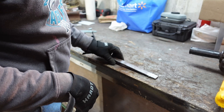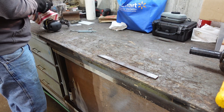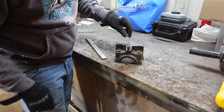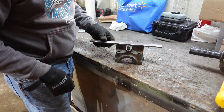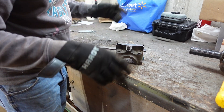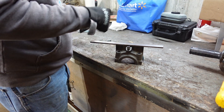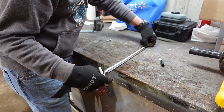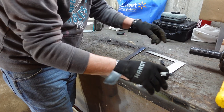So now, referring to the workshop manual as I mentioned, we're going to cut and drill holes in this to get these bolts lined up so we can get it in there. The workshop manual gives you a picture with dimensions. I'm going to find the exact center of this bar, mark that, and then drill off of that point. We'll call the center at six and a half inches. Make that mark — all right, it's nice and straight.